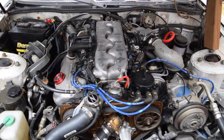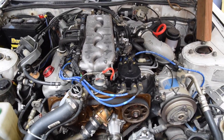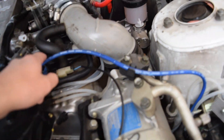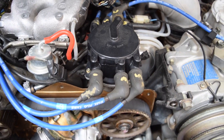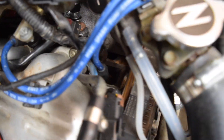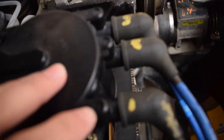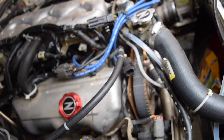I'm not going to pull all of my plugs, but I'll show you basically how to do it. This is your distributor — you've got three plugs on this side and four on this side, but this one here is a coil wire, so that's not actually a spark plug wire. Follow these wires — it's easier when they're blue. We've got one up front, one right there, one right there, and one that goes right under there. These are cylinders one, three, and five — it says that on top of the distributor.